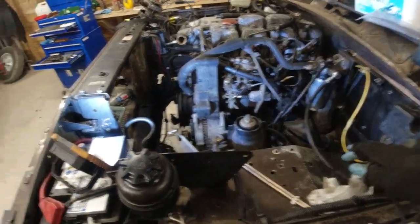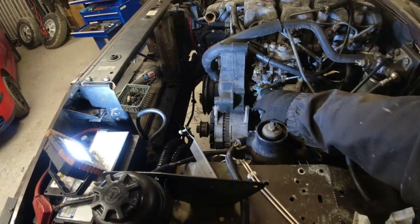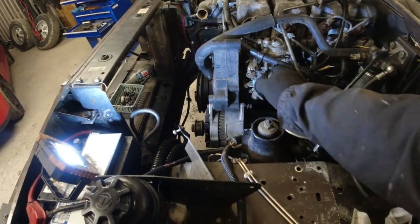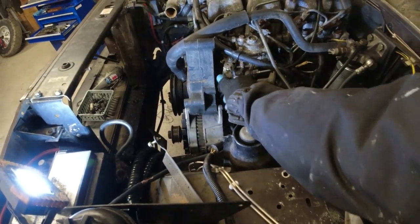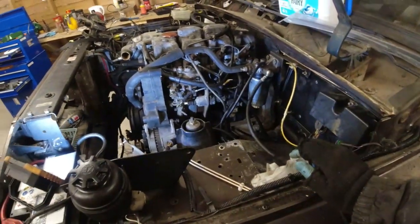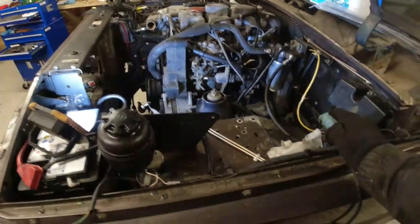But it's some sort of enrichment device, and I'm guessing what it actually does is it moves the throttle backwards and forwards. You can see there's a bump stop there, which has been adjusted onto the back of the throttle. Throttle, when it doesn't have the enrichment device on, will just work like that. So I need to check that out.